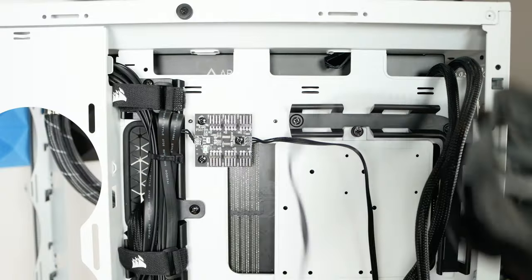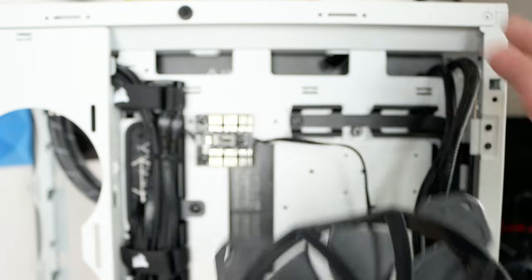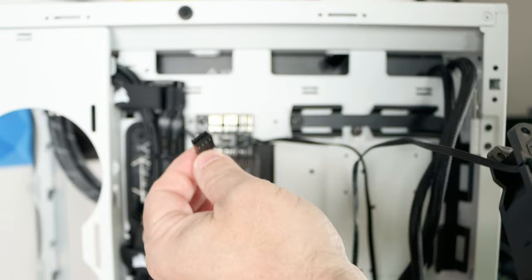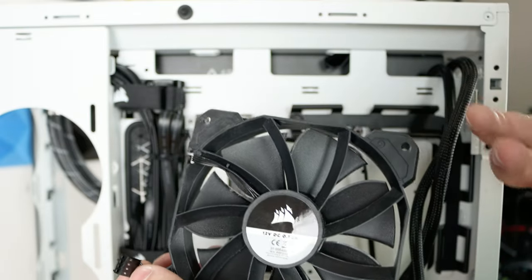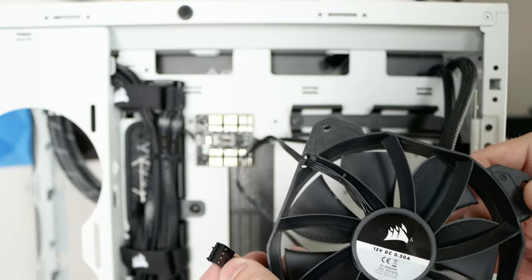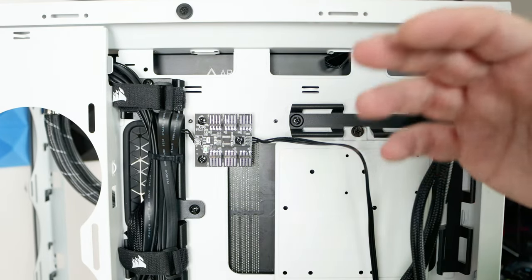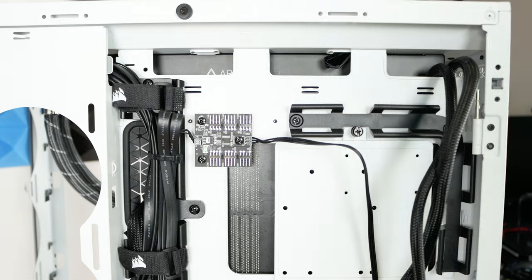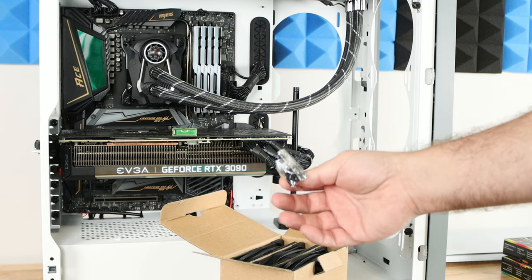One thing to take notice of: these are four-pin fan headers. On some older or even newer fans you'll only find a three-pin fan header. The difference is the four-pin allows PWM control within your BIOS, so it can ramp up speed when it gets too hot and slow down again. With only three-pin headers your fans will run at 100% unless you have a way to regulate voltage for that fan header — some boards do offer that within the BIOS.